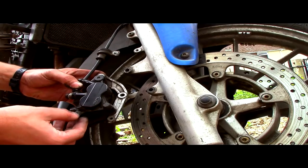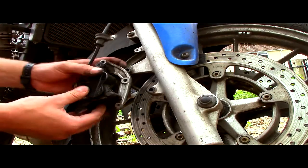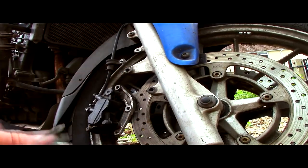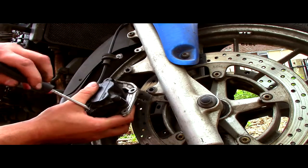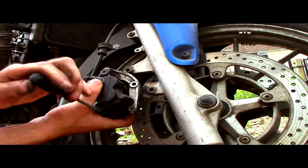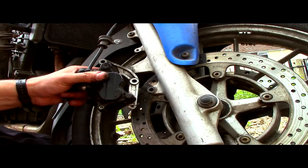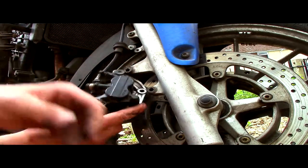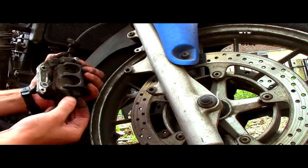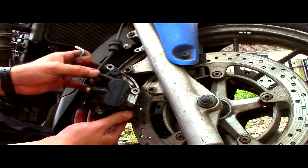As the caliper sits on the bike, there's a screw at the bottom of the caliper — just there — so this needs to be undone. That's what we're doing now, with the screwdriver that's in the set. Keep it somewhere safe. That's a nice easy little tiny grub screw. Inside of there there's an Allen key which unscrews this bolt that retains the calipers in place, so after that they should just drop out. We'll unscrew that using the tool that's with the kit.